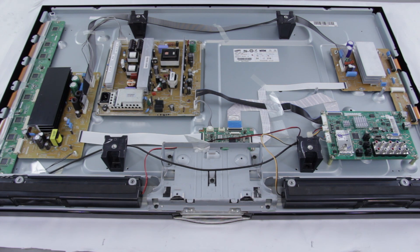The first part we are going to look at is the power supply, which is right here. The power supply takes in and distributes power throughout the TV. This board is either directly connected to your AC power cord or is connected to the AC adapter. Some common problems that can happen with your power supply is that you have a dead set where your TV does not turn on and you have no standby at all — then you know that you are not getting any power to the TV.